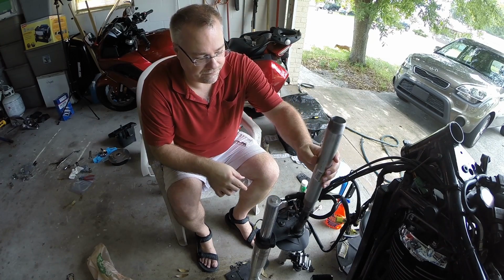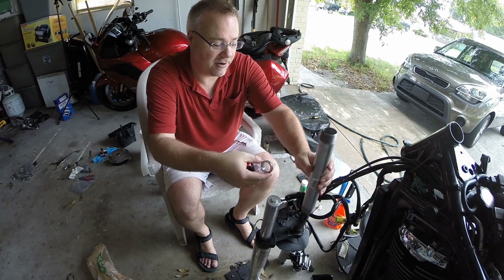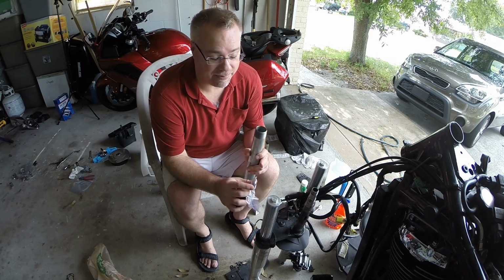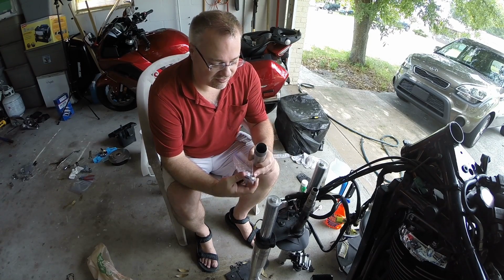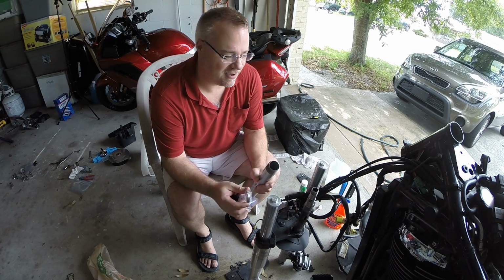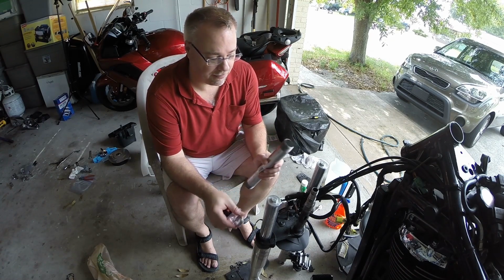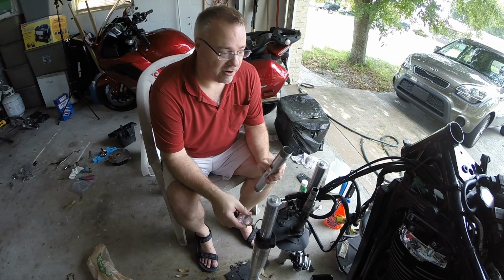And then the pipe I'm going to pound on, which will hit the old bearing, which is on top of the inner race only of the new bearing, because one wrap to that new cage means you need a new bearing. So I'm using this old one to my advantage. It's got the nice lip. If you turn it upside down, it's only going to hit the inside race of the new bearing, so it'll be completely safe. And I'm hoping with the temperature, it's going to slide pretty much all the way down. Just need a couple hits, and we'll call it good. And then, of course, I'll grease up the new bearing.